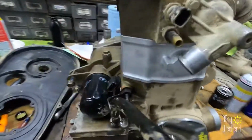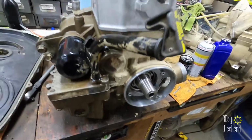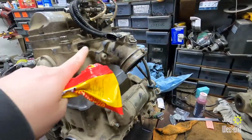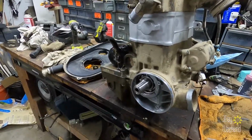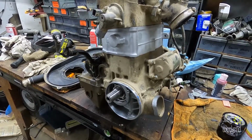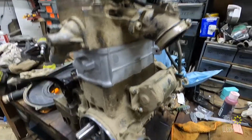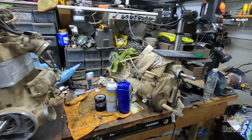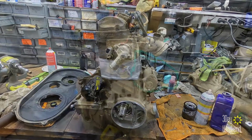Next we're priming the oil. Change the filter. Fill it with oil. We're going to take out the spark plugs and touch the starter and make sure that oil pressure builds up first. And then once we do that, I'll compression check each cylinder, and if everything passes, we will rejoin it to the transmission and then put it back in.